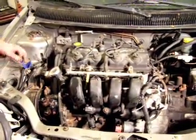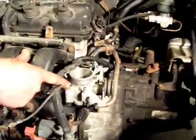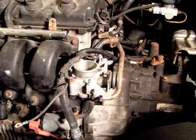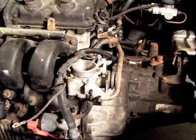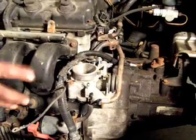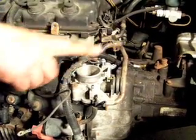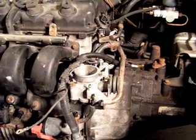The other thing I'm going to do is use the throttle body off of the car. The newer cars have a throttle position sensor which tells where the throttle is when you put on the gas. That throttle position sensor, of all the ones I've checked, has been a 5k pot — which is the same thing most electric car motor controllers want to see to control your speed. The advantage of using the throttle body that came off the car is that the cable length, the mounts, and everything is already set up for the throw of the gas pedal and the angle you need on the throttle. All you have to do is bolt the throttle body to the body somewhere, run the cable to it like it was before, pull the wires off the connector, and you're ready to run them right into your motor controller.